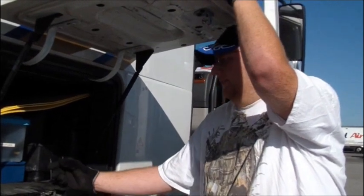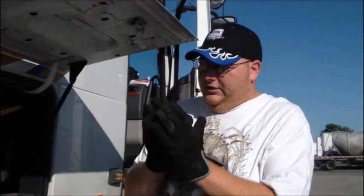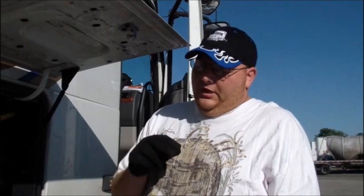Only thing that kit doesn't provide is the actual headlamps themselves and the flash lamps for the front end of the truck. Those are a couple bucks, though. Two for the front of this truck is about $6. So I found them. That was the first thing I had: if you're in a Volvo and you see the hazards blinking really fast, you got a front turn signal out somewhere on the truck. In their little instruction booklet, they do not put in there how to change the bulbs, or amber marker lights up in the front corners.